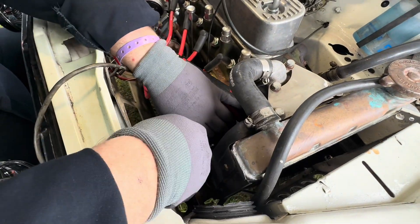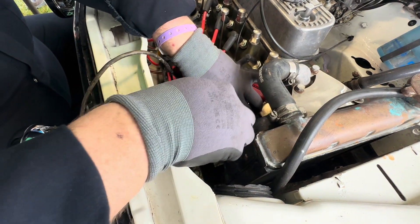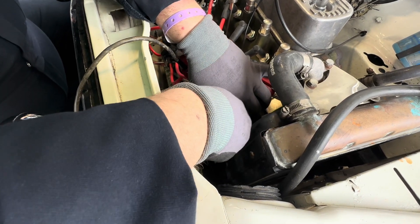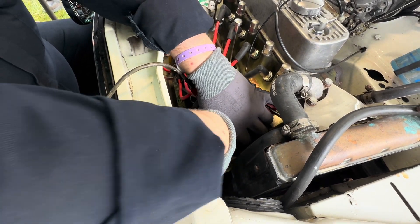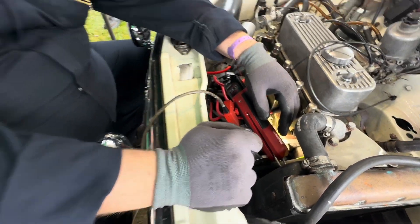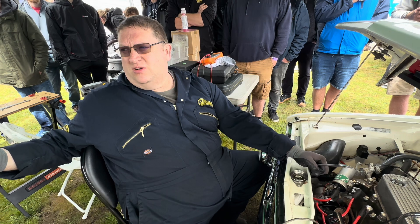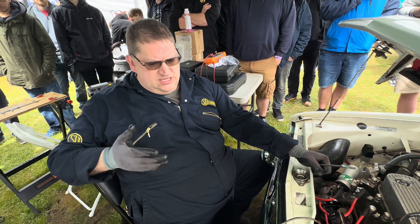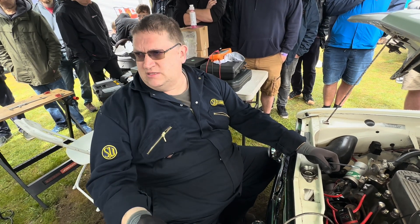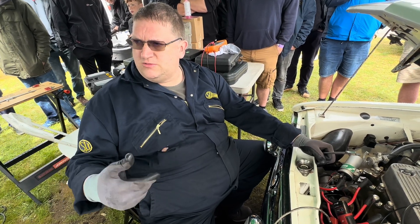All you have to do with the timing marks is verify that you've got the TDC mark on the crankshaft lined up with the TDC mark on your engine. Some people are building engines with no marks on them at all — no pointers or nothing. This is a rookie, amateurish mistake — I've seen it from supposedly professional builders. They don't put timing marks on them. This one I just can't see because it's been nicely painted. But if you're going to build an engine, highlight the marks in silver or white paint so you can see what's going on.